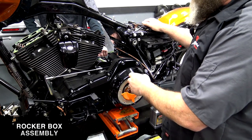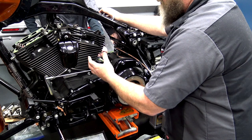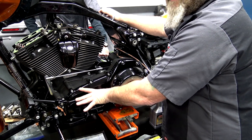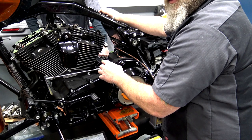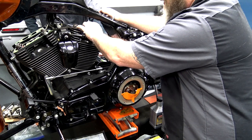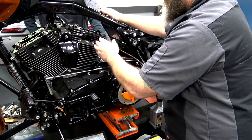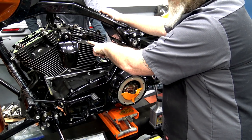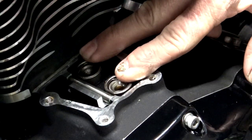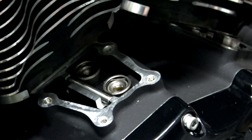When we took the motor apart, we had to make sure that the cylinder we're working on is at top dead center on the compression stroke. To check it, you can always use a screwdriver after removing the spark plug up here. Put the bike in sixth gear so it's easy to turn the rear wheel. Start turning the rear wheel until your cylinder comes all the way to the top and your rockers have no pressure on them — you should be able to reach in and move them. You can also check by making sure the lifters on the other side are flush with the case, which confirms top dead center on the compression stroke.